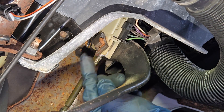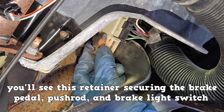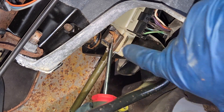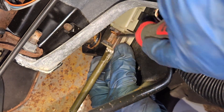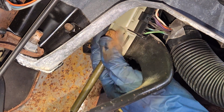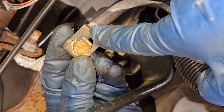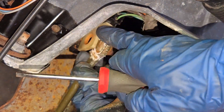Next, move to the driver's footwell area. Follow the push rod that comes from the Hydro Boost — you'll see a retainer securing the brake pedal, push rod, and brake switch. Using a flat head screwdriver, wedge it in between the rim and the top clip, basically prying open the top portion, then push out the retainer — it's easy to slip off. The metal retainer has two half holes; push that rod from the small half to the larger half. With the retainer off, you might need to pry off the push rod and brake switch from the brake pedal assembly.